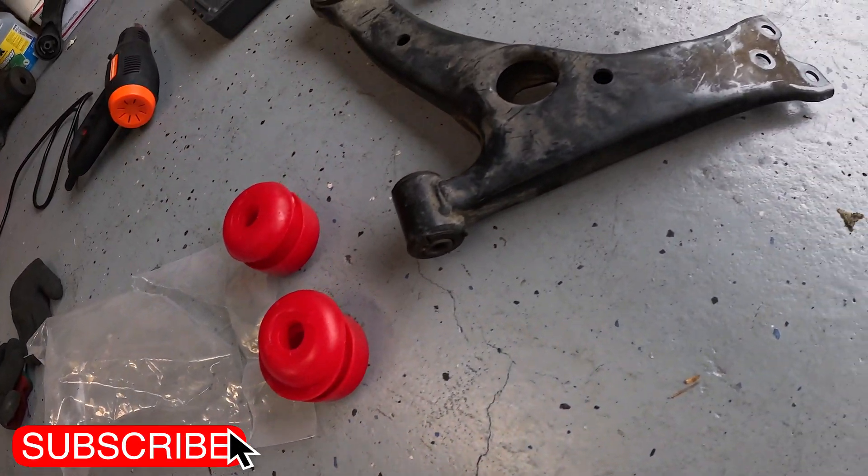Definitely want to orient them correctly — let's hope I do that. You want to keep this metal ring inside the bushing, inside the control arm — we're not trying to push that out, we need to save that. So we're gonna be removing the rubber portion, cleaning out the inside of that bearing race, and we're gonna recover this vertical piece and clean it up with a wire brush because we need to reuse that part.